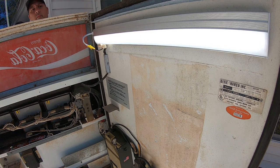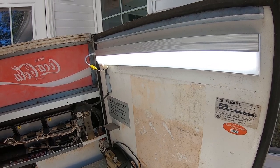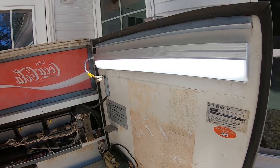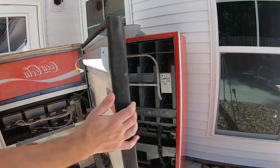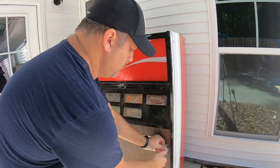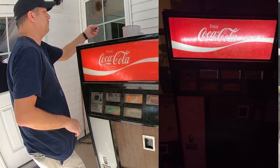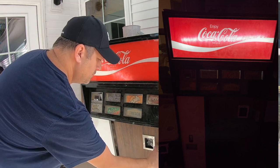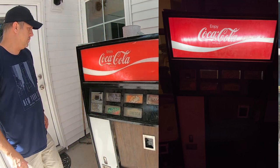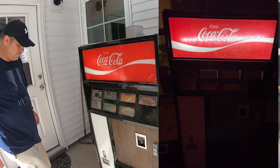Machine plugged in, light lit up just fine. However, there's a metal strip on the left that pushed on the wire when we closed the door, which popped the light off. I noticed it because it was bright out when I was filming — if you look closely, the light is slanted down. We did fix that off camera. Here's a picture the owner sent us after dark — it could be diffused a little better, but it looks pretty cool at night. Definitely better than before since there was no light previously. Hope you enjoyed this video on how to convert an older soda machine to LED lighting for under ten dollars!